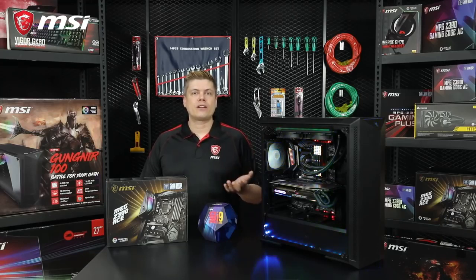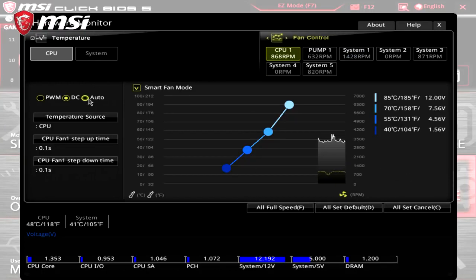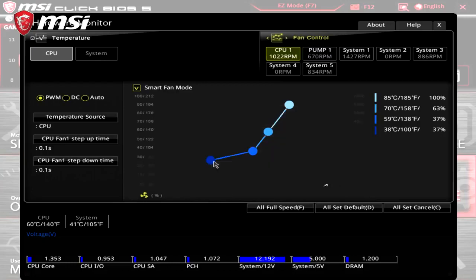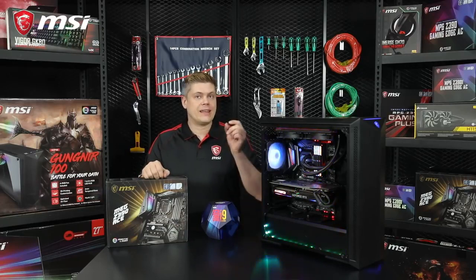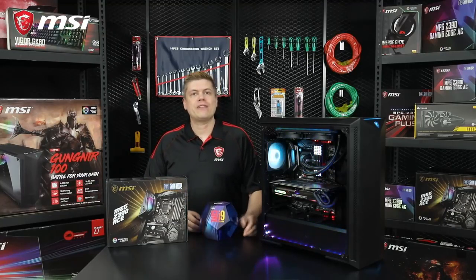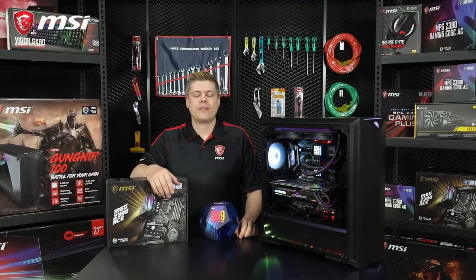Don't forget to visit the hardware monitor section of the BIOS, where you can adjust your fans or change the default smart fan profile by dragging the circles. You can set a quieter profile for streaming or 4K gaming, and a more aggressive fan profile to kick on and take out the heat when you start rendering. So with some component pre-planning and assembly, you can hit the 5 GHz mark with just a little tweaking in the BIOS and squeeze a good amount of extra power out of your CPU. We want to know what results you got with your setup — please let us know in the comments, and let us know any ideas you have for upcoming episodes. If this guide helped you, hit that thumbs up button, or tell us what we missed. Thanks for joining us, and happy overclocking — see you in the next episode.